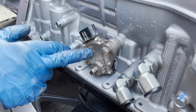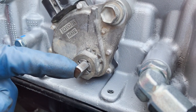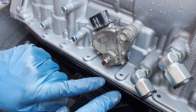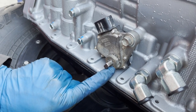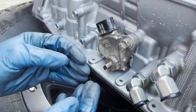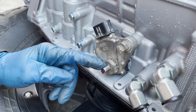This park neutral safety switch is made out of plastic and you have to be really careful with it. Once you get the nut and claw washer off, it's really stuck on the shaft. These plastic fins with gaps between them are all part of the switch. I ended up breaking one of the fins because the plastic is really old and brittle. I suggest spraying a little penetrant in here, then slowly work it off the shaft. We epoxied the broken fin back on and were able to fix it.